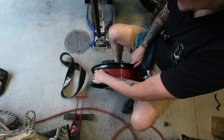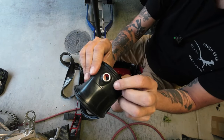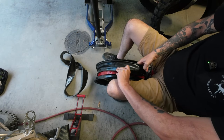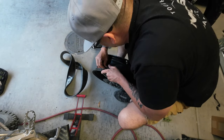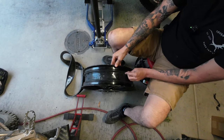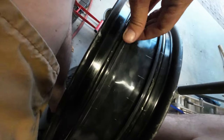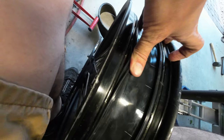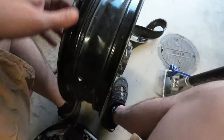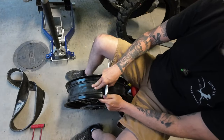Some scuffed up rims - you'll have that. I just wanted it to hold air. It's got a little metal seal that's got to go in the groove here. I'm just gonna get it started and work it around. You can see it's just a little - get that first lip down in there, and then I'm gonna tuck this lip down in there. I got it all the way around, got my hole over my hole, just got to tuck this in all the way.